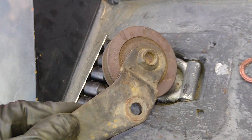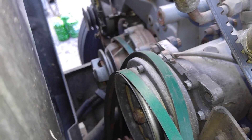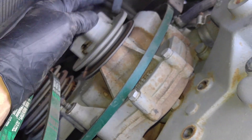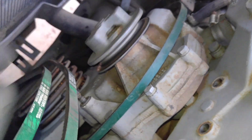So I have to buy a new idler and a new O-ring. My buddy said he'll rebuild the water pump for me — it's an original Ford, I sent him the part number. He says water pumps never go bad unless the seal's bad. I said no, it's noisy. So the water pump comes off, the rear housing comes off. It's not as bad as I thought — they don't make it integral with the timing cover. That's two separate pieces, separate castings.